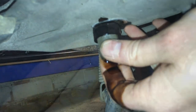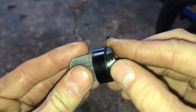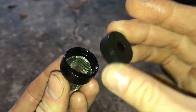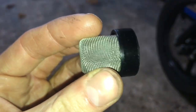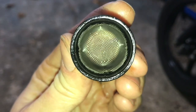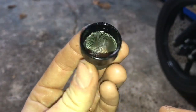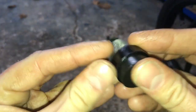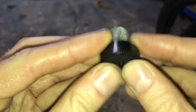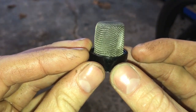Just having a look at the filter off the bike — the top piece comes off. You can see it's literally just a sort of wire gauze, nothing complicated. It's a case of cleaning that out with a rag or tissue, just making sure the rubber piece is back in the top nicely, and then popping it back up into the engine block.